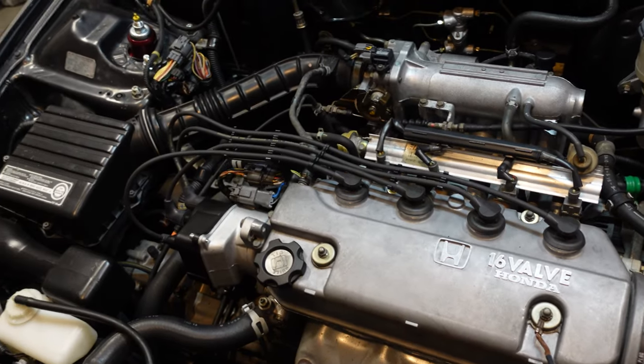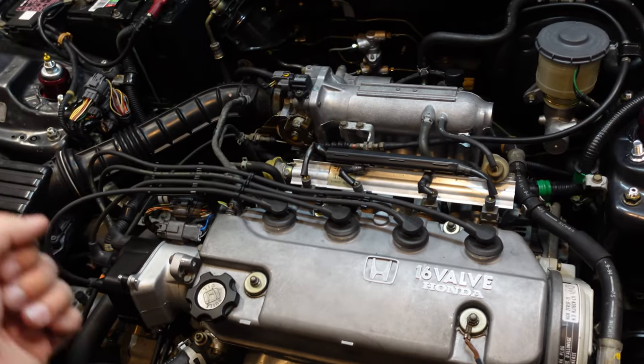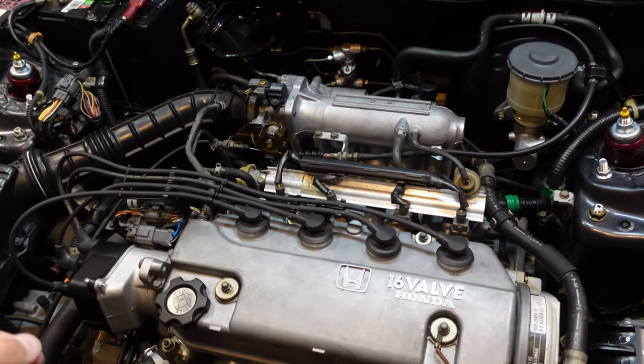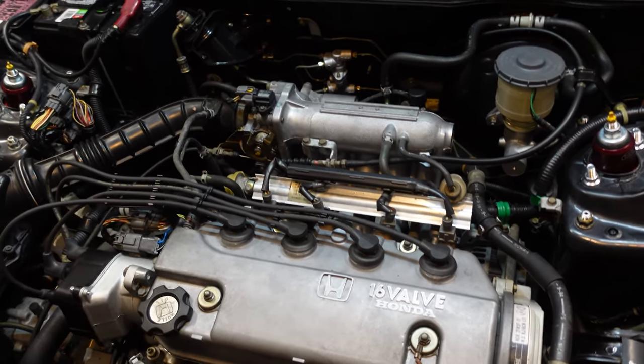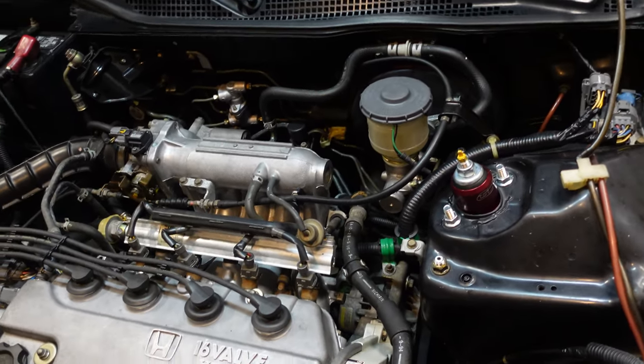Last thing regarding shifting — on a stock D-series transmission swap there are shifter bars that go under the middle of the car connecting to the interior shifter that you'd have to swap. But since we're going to a K20, those use shifter cables instead, so we don't need to worry about that — you just run those through the firewall when you do the K20 swap anyway. And that's basically it guys, it's really not that complicated. In total, all the parts I paid for is around two to three hundred dollars, including the brake pedal, gas pedal, clutch pedal, master cylinder, and even the custom wiring harness. Thanks for watching — if you have any questions throw them in the comments, I'll see you next video.